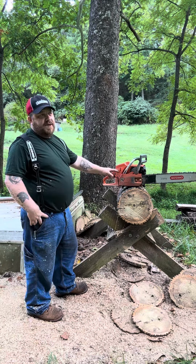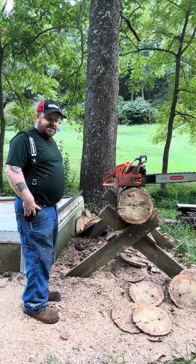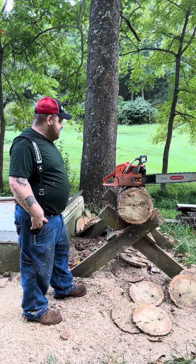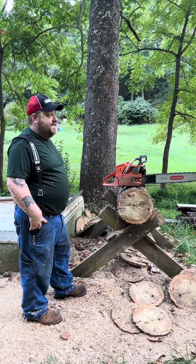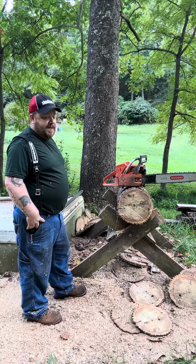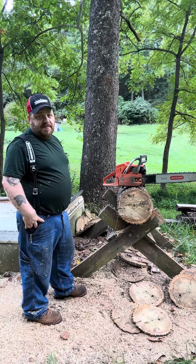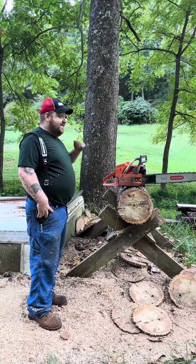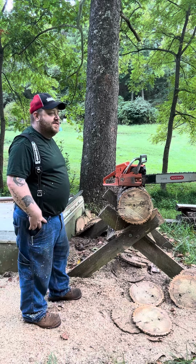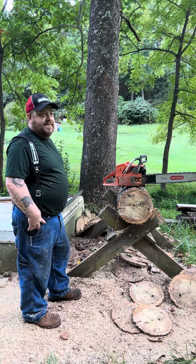But their main problem was the intake block leaking. I've yet to ever get a Chinese one to seal or Chinese gaskets to seal. If I can find a new OEM block, I'll put a new one on it. Or if I can't, I'll buy a used one and then get OEM gaskets. And if I can't get OEM gaskets, my buddy Skunky Bob, John Bob, he gave me some gasket material. The exact same material that Husqvarna used on his gaskets. Exact same stuff. You just got to cut them out. So if I can't find them, I will make them.